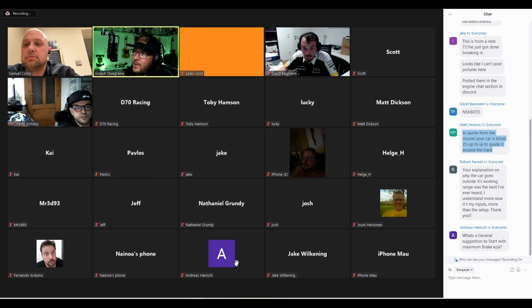But what I would maybe recommend even more than that is to just try some negative expo. That is really good because it reduces that initial response of the servo, but you still have the speed there when you need it. So I wouldn't go overboard with that, but let's say 10 to 20% is already noticeable.